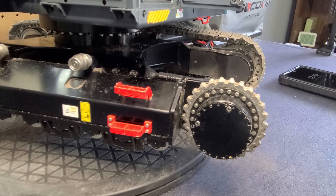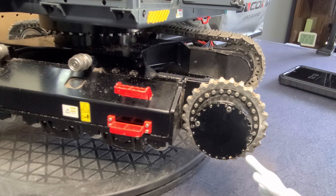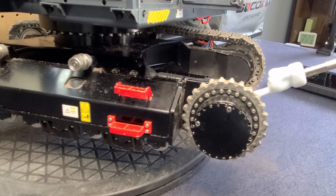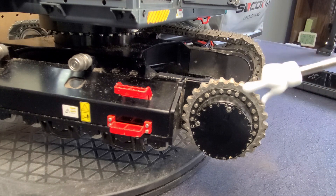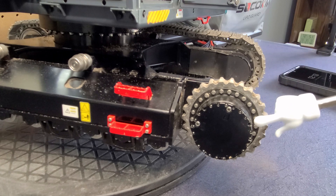I installed the parts that Toucan Hobby sent me. They did not fix the problem. I've been thinking about it and reached the conclusion that the continuous strip gears in here are not the problem — they are a symptom. What's happening is something might be caught up behind here that's preventing this from turning, and when it can no longer turn, it forces the gears inside to strip themselves.